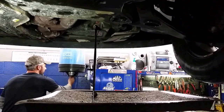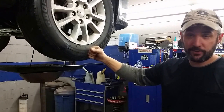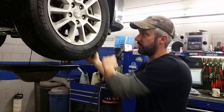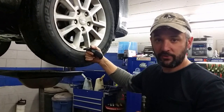Go ahead and let the engine oil drain for a while, until it's just a steady drip — it takes a few minutes. As your engine oil drains, it's a good time to go through and check your tire pressures. Have a look at the tires. If you've got the car jacked up where you can wiggle the front end, go ahead and do that — check for loose parts, loose ball joints, tie rod ends. Grab your tire and give it a wiggle; if something's loose, you'll feel it. Use a good gauge and see where the tires are at. This one's at 32 and a half; the car calls for 36. So we're going to adjust those pressures on all four tires while the engine oil drains.